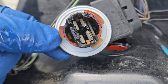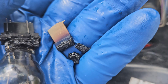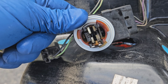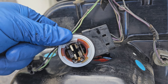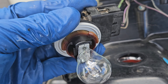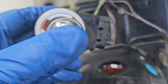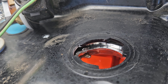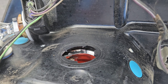That's the kind of pliers I used — pretty easy to remove with those. It did break the tab on the other side, right here in my hand. You can see how blackened it is — it got so hot that it probably became super brittle and was stuck to the bulb, so it just came off. And if you look down inside, that glob — it almost looks like solder — that is the housing melted inside too. This thing definitely got hot when it shorted out.